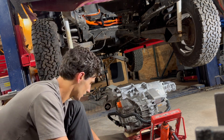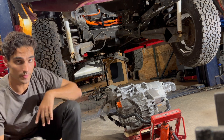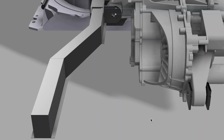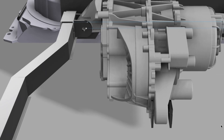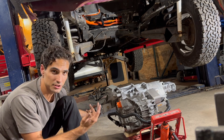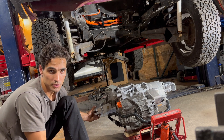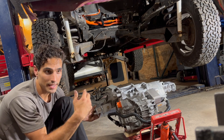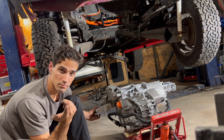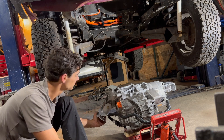There are our motor mounts. You can see how this slots onto the frame rails and then bolts through from the outside of the frame rail in. Initially I thought maybe I would weld these to the frame rail, but I actually need this to be removable to get the motor in and out. It also makes it adaptable to any Vanagon — so even if one day I get rid of this truck, I can put this into a regular stock tin top or camper version of the Vanagon. Or if anyone wants to convert their own Vanagon, send me a message. Let's put this in.